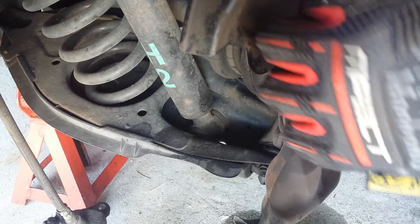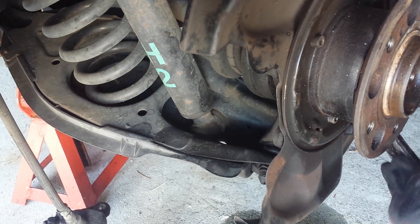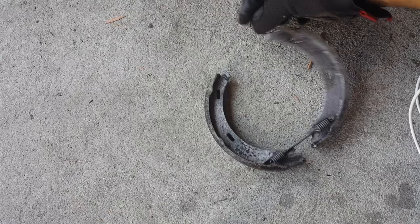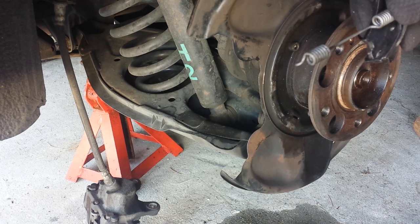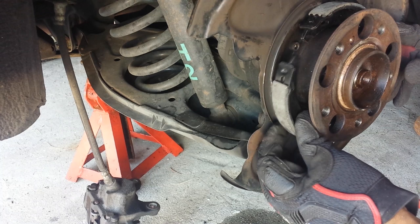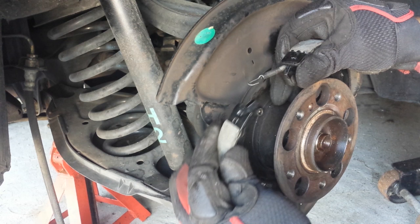To get these things off you just push, push, and turn — simple as that. Take off the spacer. Once that is off, everything will loosen up a little bit more. Get the spring off and it pops off like that. Now placing the parts on the ground, we need to reconstruct with the new parts what that looks like. This loaded spring here has to be in front of the brake shoes. The top springs go behind. Let's put the rear springs up top.